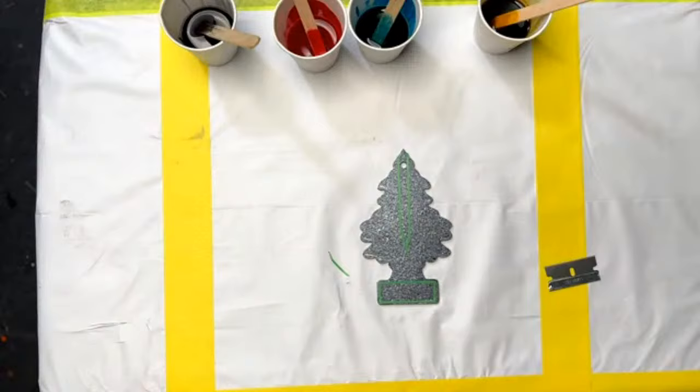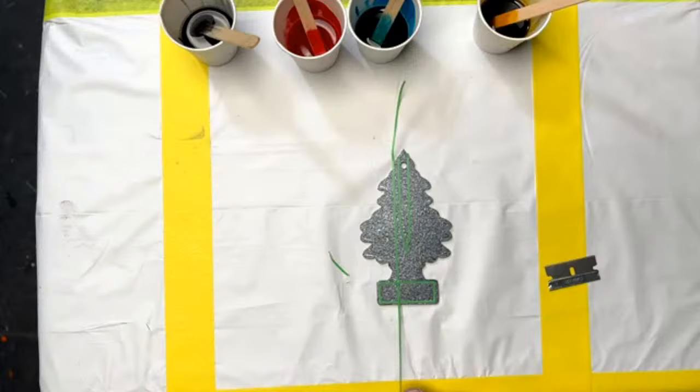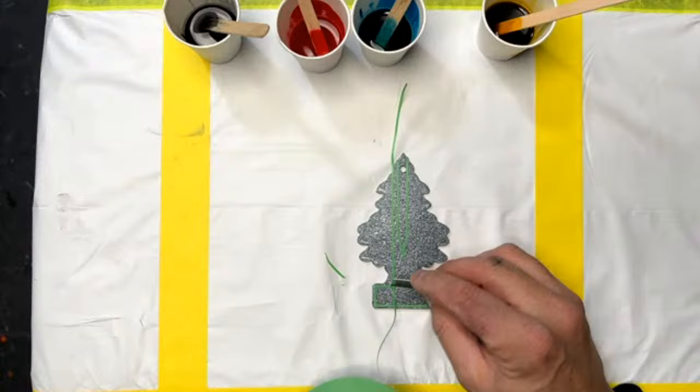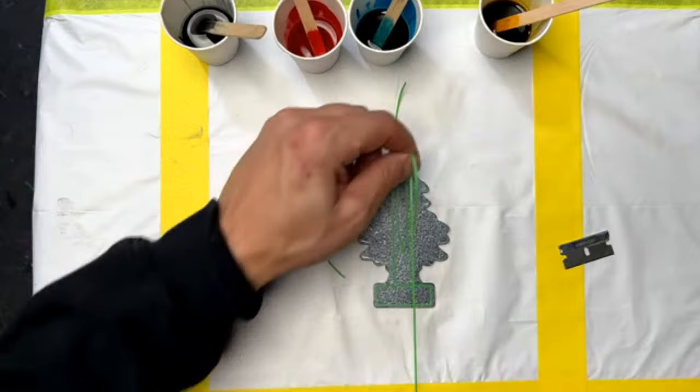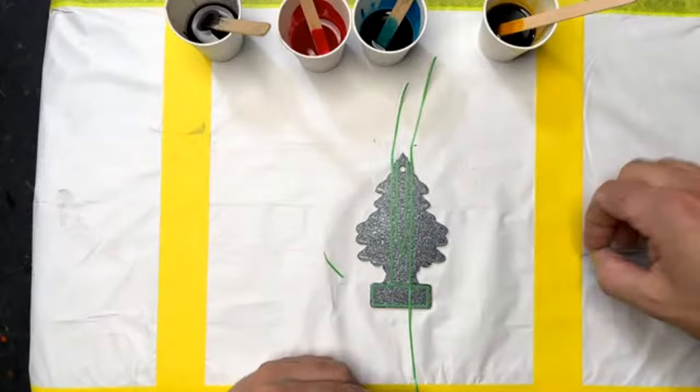My panels were blushing — humidity was 89, air temp was 69. What temperature do your panels need to be in order not to blush? They always say 70 degrees would be the optimal temperature for painting. Anything over that the paint's going to react different and dry different, especially when it comes to base coats — problems with mottling and uneven textures can happen. But 70 degrees would be optimal.